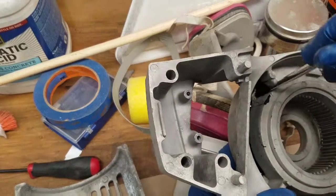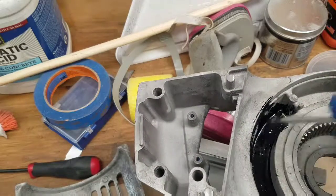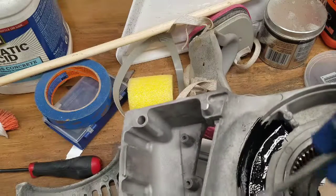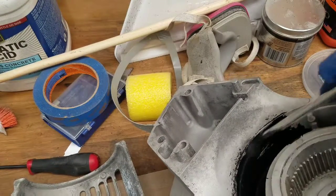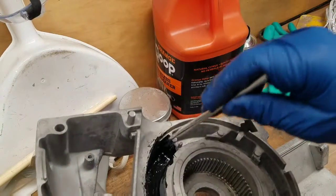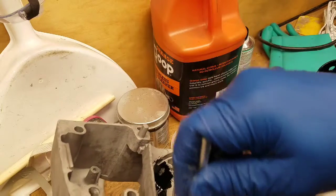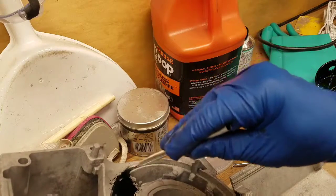So, all these areas were powder coated, and as you remember, the powder coat was just flaking off. Now, what's to say that the POR won't flake off either? Well, I hope that I prepped these well enough. I mean, the key with POR, like any other coating, is prep. So you know, I tried my best. I sandblasted it and I degreased it and cleaned all the schmoo, as Avi would say, off as best as I could.